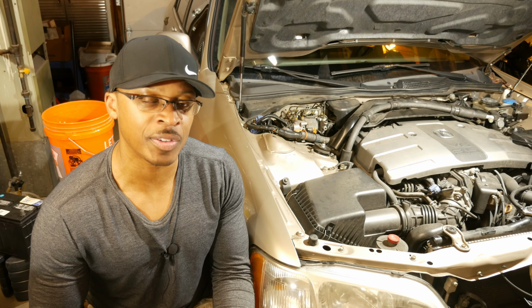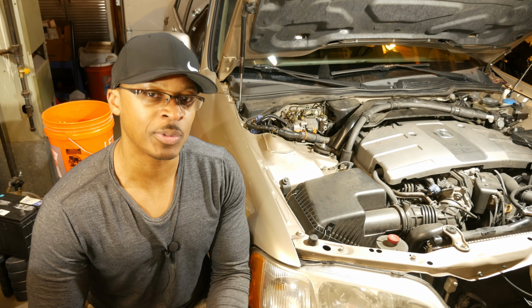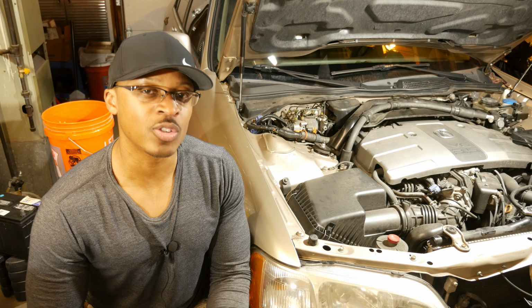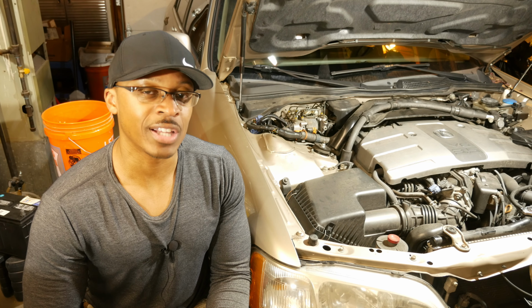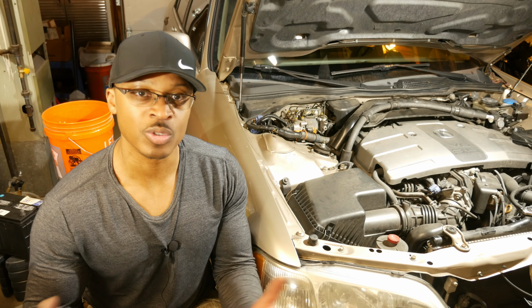If you're getting a lot of oil in the cylinders, or if you've got some combustion issues going on where maybe your spark plugs are really dark, maybe you've got a lot of carbon buildup, that can also tell you maybe you have a misfire going on. So that's one thing. If you look at the Acura Legend videos, I talked a lot about that in those videos and where I had a misfire. The spark plugs were just really charred.